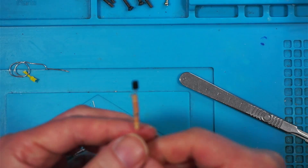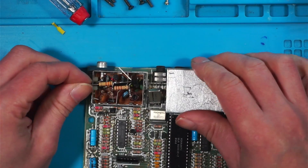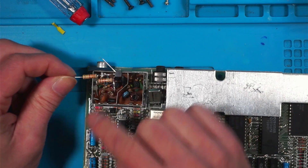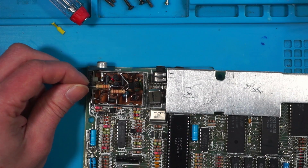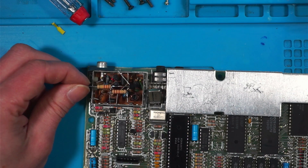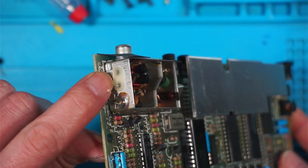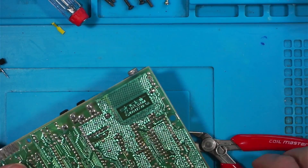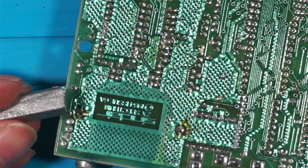With a nice blob of solder on those two points — I watched another video with Mark Fixer's Stuff and he took the whole board out and replaced the inside board with a ready-made mod. I think I'll have to follow suit and do that, then it'll fit in nicely. This is five volts in and this is video in, so I'll snip them and take this off.